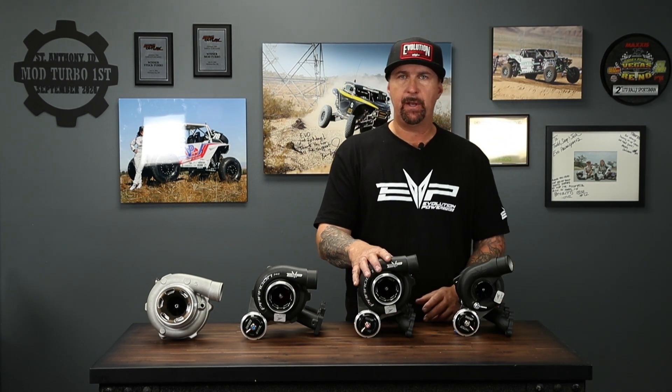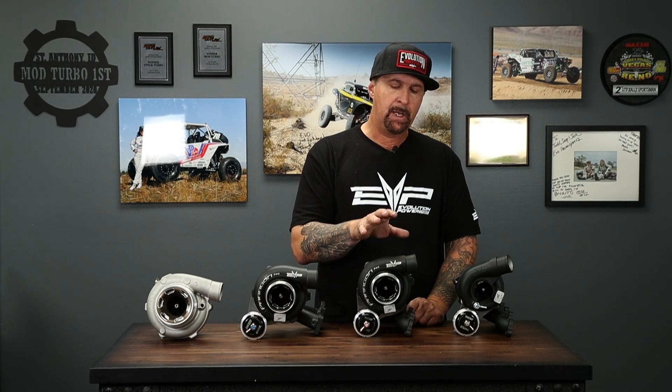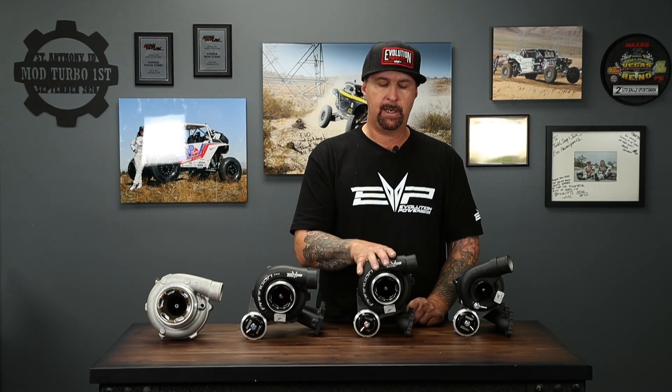Moving on to the 46 mil X3 — it's going to be in that 355 range, rated between 350 and 360 horsepower. Very good spool, significantly better than what we currently offer, with great top-end power. This takes a few more go-fast goodies to go along with it, like a plenum and our race intercooler. It's a very durable, trailable type of turbo kit. Tune options available are 91, 110, E85, and 100 octane for both the MG1 and ME17.